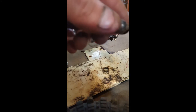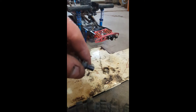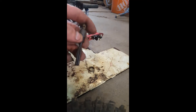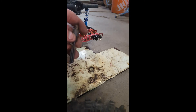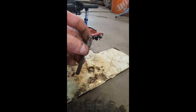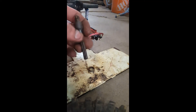You can see how it's egg-shaped — you probably can't really tell on camera, but that's what happens. The pins get sloppy, they fall or break. We've got our new drive shaft end here — this is a different end compared to the one that was in it. Make sure you grease these up good when you put them in.